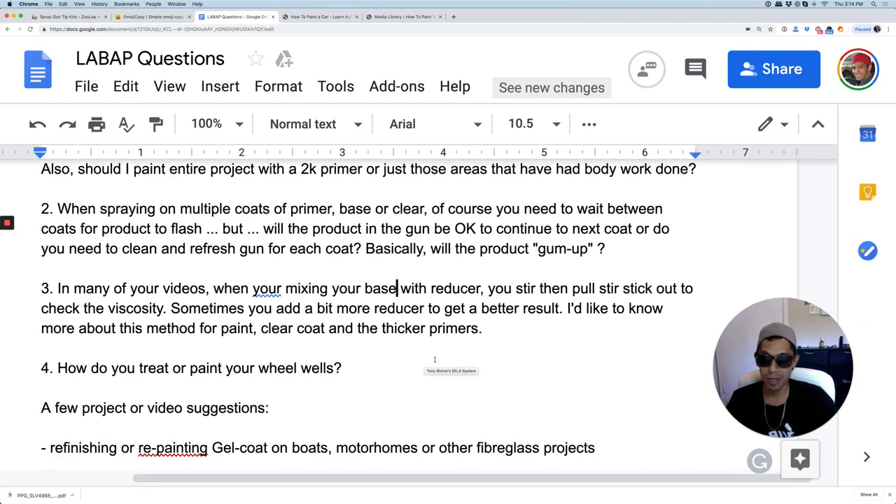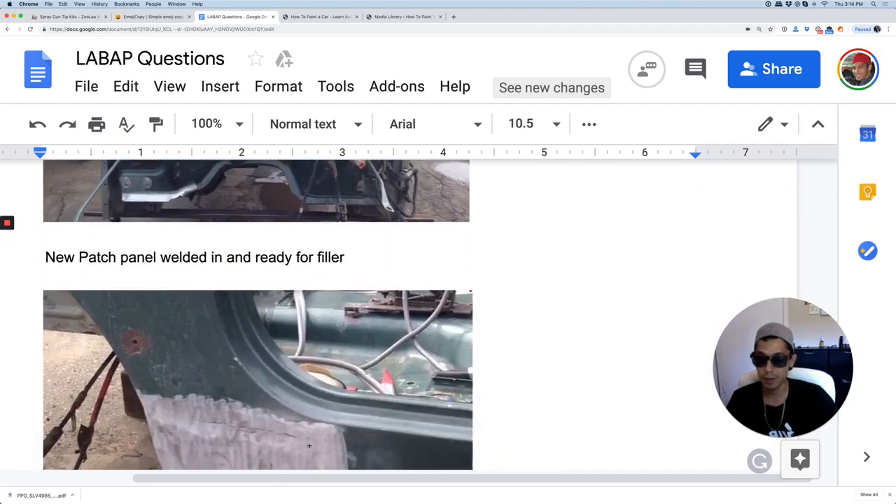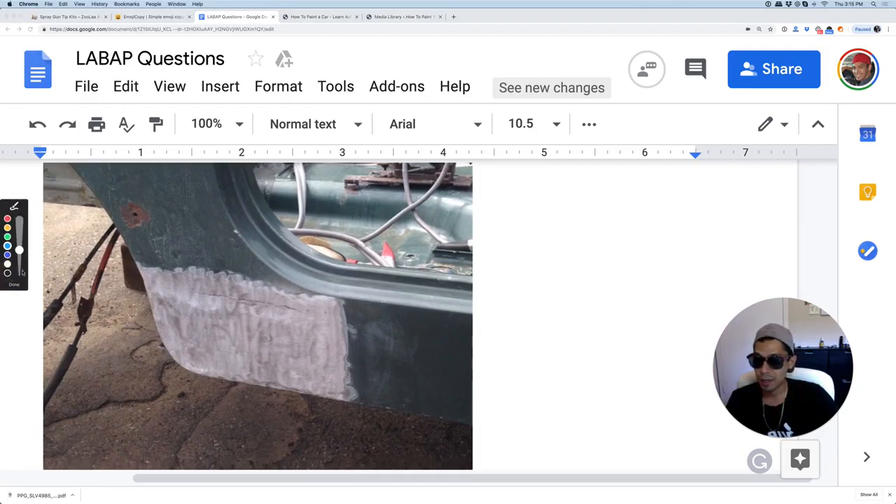Hopefully this video helped. Here is the truck he's working on — a Jeep Wrangler. He put in a new patch panel and welded it in, and it looks really good. His next step is to scuff up around there with 80 grit. I would even go up to that rusted spot — grind it down to bare metal, treat it with some vinegar water, a 50-50 mixture of distilled white vinegar. That'll kill the rust. Then wipe it off, scuff it, and you can lay some body filler right over it. If you can get to the backside with some undercoating, do that too.